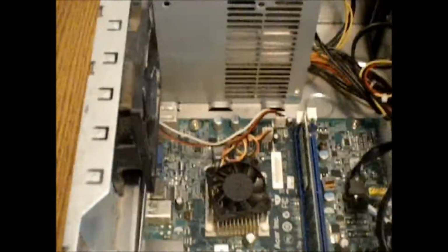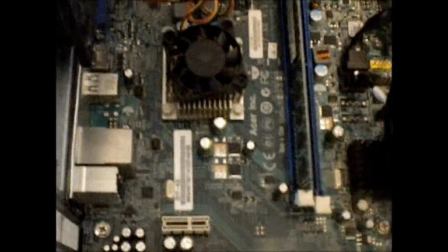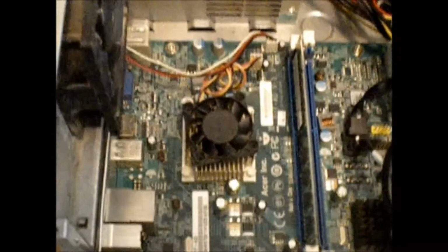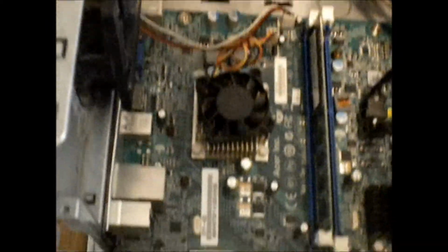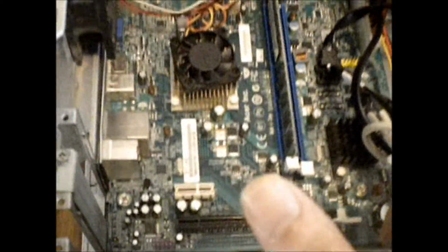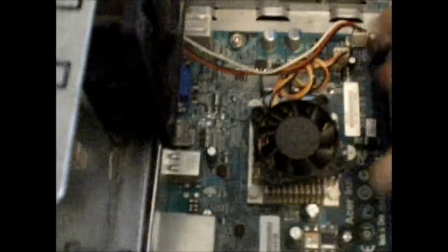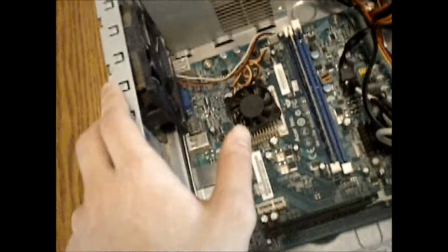This computer is probably going to be used for very light gaming. It's only 1.65 gigahertz. It's fairly weak. It does have the Radeon 6320 built-in GPU, since it is an APU, but it is by no means a gaming computer. This thing is fairly weak, and it runs fairly hot because you cannot upgrade the heatsink on this, and it is really freaking small. Under load, this thing gets probably 70-75 Celsius.